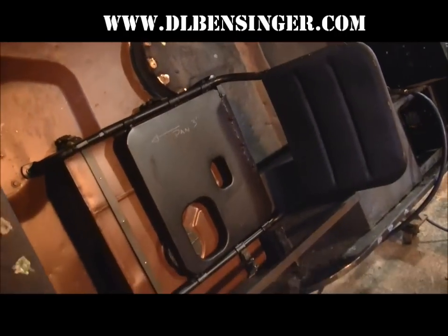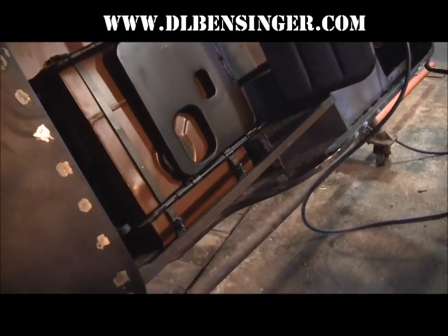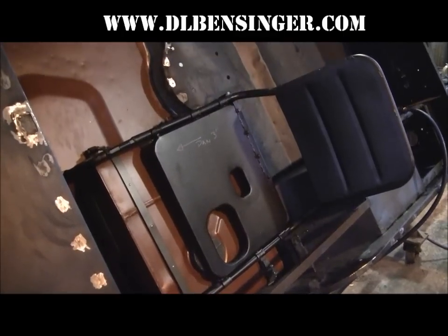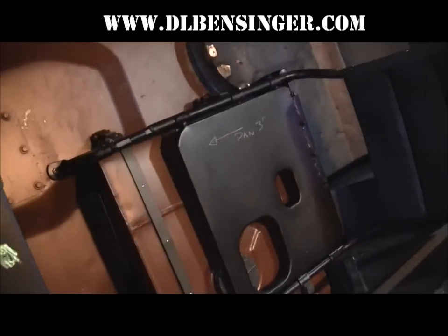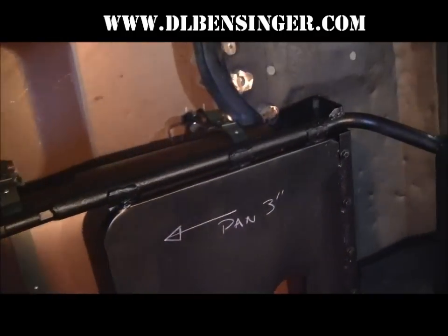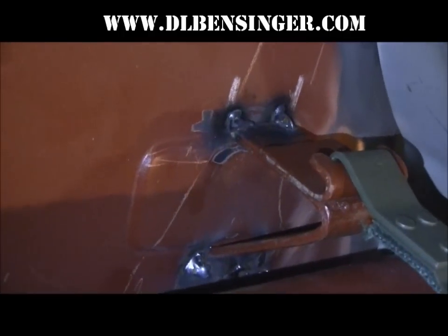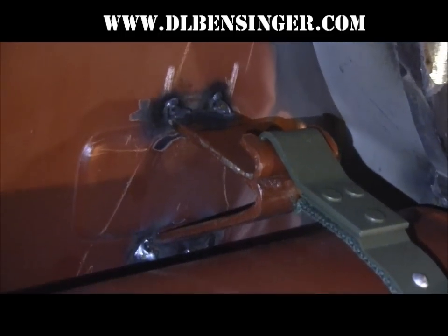is go ahead and install the fuel tank and the fuel tank straps and the seat. Anything that affects or touches the parts that you're putting in, you want to put in and try. Make sure they're going to fit. Now, one issue on the gas tank, when they're putting the new floor in, the gas tank brackets here that hold the strap on, these are not included with the body. So if you don't have these off your used body, you want to get them from your supplier.